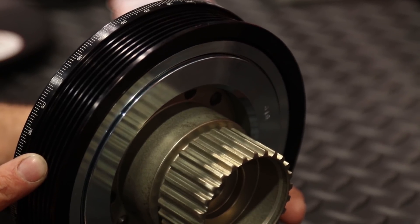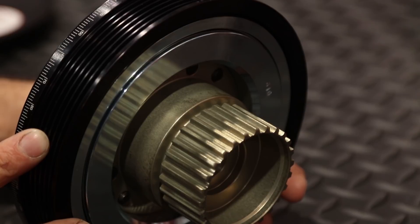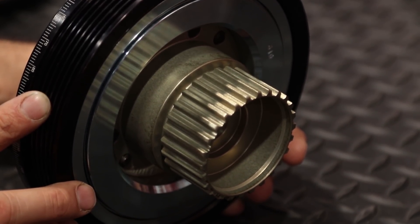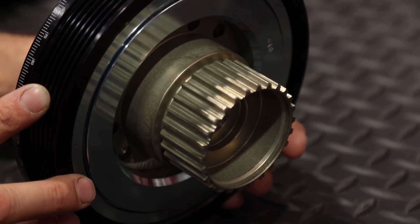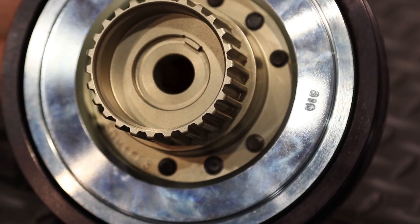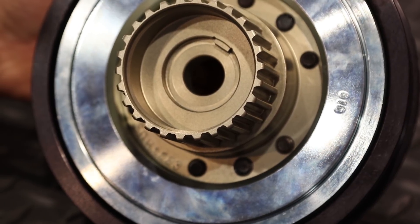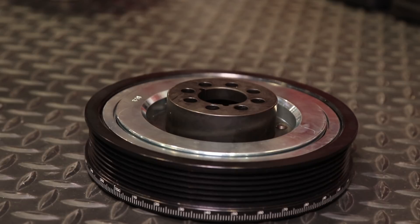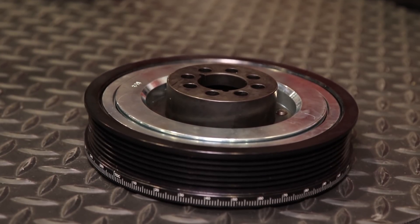We've made our parts a little thicker and stronger than OEM stuff and it comes with correct length bolts to retain it. And the guys that are really going all out — your guys that are at World Cup right now racing imports versus domestics — we integrated the lower timing pulley into the damper, kind of like we do on our Evo and a couple others, and it is absolutely the strongest way to retain the damper on your VW or Audi.